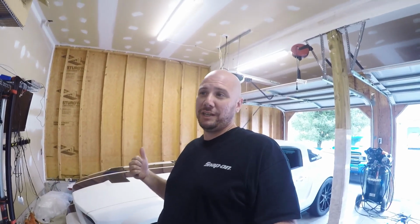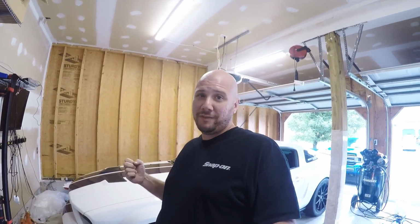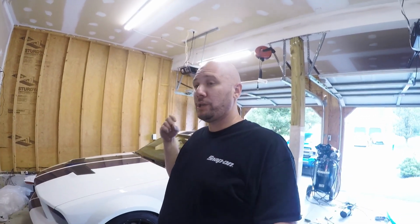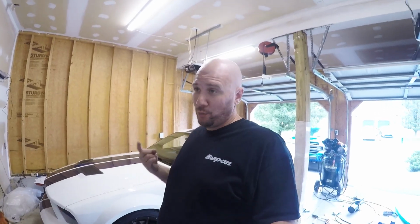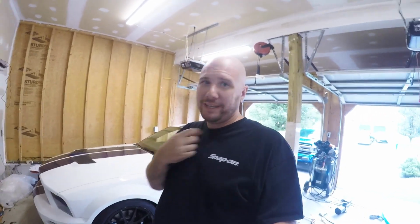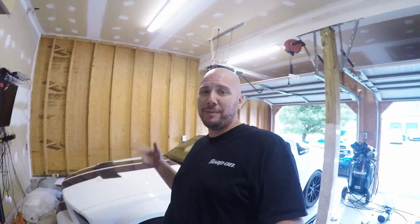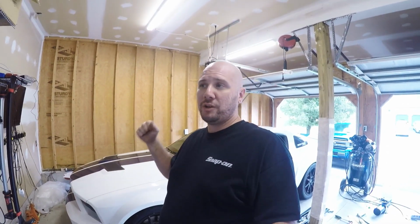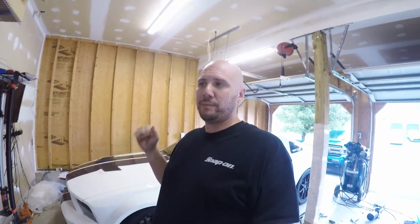I will tell you, my experience with synchros is it's always going to be the same scratch unless you're double clutching it. Lockouts I've experienced are usually clutch related, so this could very well be clutch related. I really am overpowering this clutch, but it could be clutch related. I will buy that. Could be fluid related. I don't like the fluids that are in it right now, so I may be dumping those. But I really do think that torque and stress and twisting under high load is what this problem is. The car shifts, I'm not going to say it shifts fantastic, but that could be the fluids.